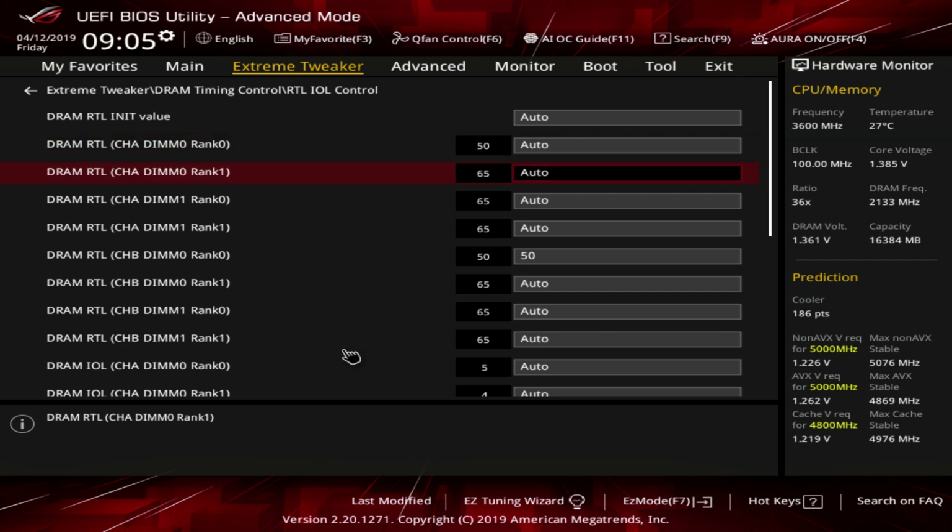So, yeah. Also, they're actually motherboard dependent. So you may find that on the Gene, it might be like 49, 50, 6, 6. But, for example, with the ITX motherboard from MSI for 4000, well, I can't even do 4000 CL12 on that board. But when I was doing 3900 CL12, which seemed like that would normally run pretty similar timings, on the MSI board, that actually works out to like 49, 51, 6, 7. Okay, so you can see that there's a slight timing difference. And then if you have really different motherboard layouts, like for example a 4-DIMM daisy chain board, then you'd be looking at completely different timings again.